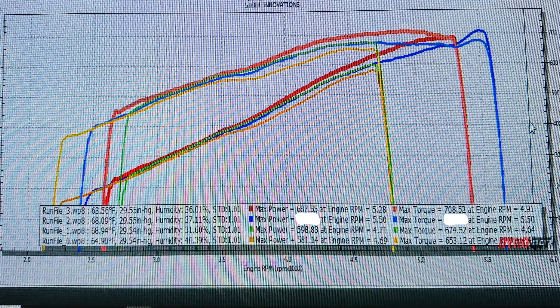We just made run number four, and sadly I had to lift early once again, so at this point I'm getting pretty frustrated. But then we took a look at the dyno and that kind of cheered me up. This thing, even lifting at 5,300 RPM, made 687 horsepower and 708 foot-pounds of torque at 4,900 RPM. It's pretty cool to see that we were hitting our goals before we could even rev this thing out where the intake manifold and the blower are really going to shine in the higher RPM. Seeing it make almost 700 horsepower with only being able to run it out to 5,200, when this thing is running right and no shake, we should be able to run it pretty close to 7,000 RPM.